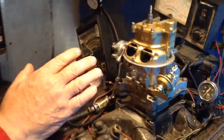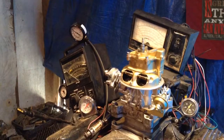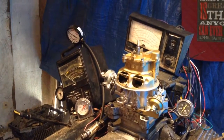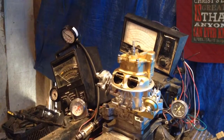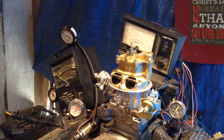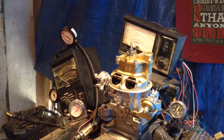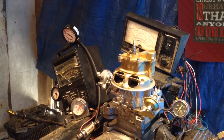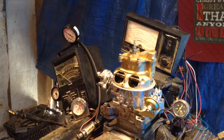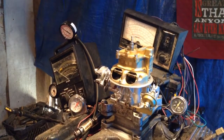She's all set, it's all tuned, mixtures are all set up, idle speed's all set up. We're ready to do the first test, which is going to be starting it up with the vehicle either in park or neutral, rev it up, and get some readings off all our gauges. Then we're going to put it in gear and engage that brake, which applies a load — much more load than the car would normally pull — just to see how strong that carburetor works throughout the RPM range as far as torque.